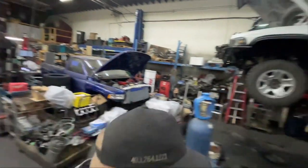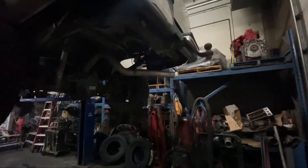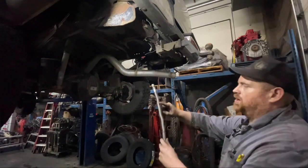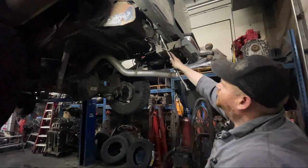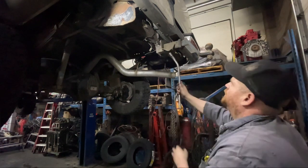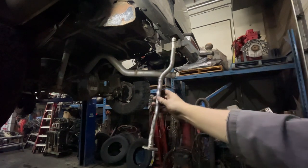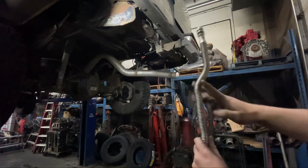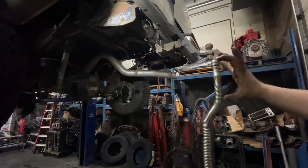Let me show you quick how I would normally do it. If this was perfectly straight and you wanted to put your bend right here, you're going to heat all the way around that tube and then stick it in something — like the trailer hitch — and it'll bend just like that. Then heat it further out and do the same thing. You can do it in a vice too. You want to have a good six inches sticking inside the pipe — I found if you use a good six inches you get a good vacuum on it.